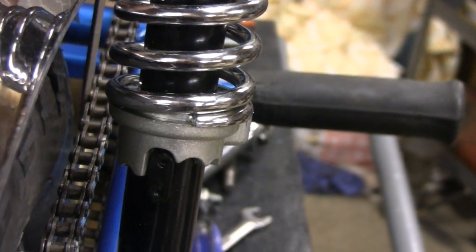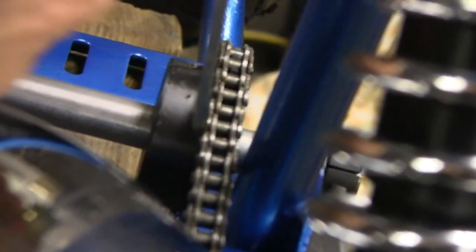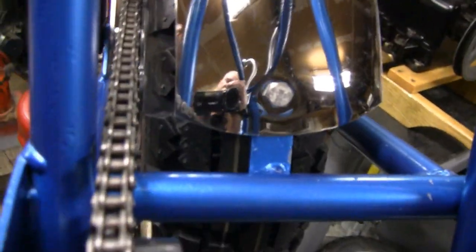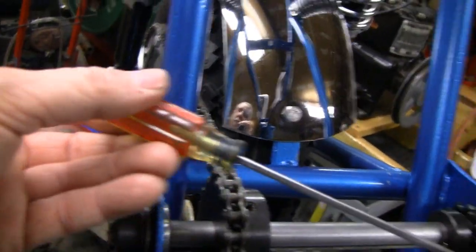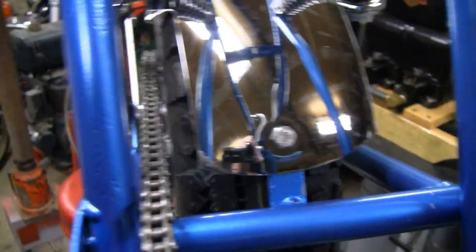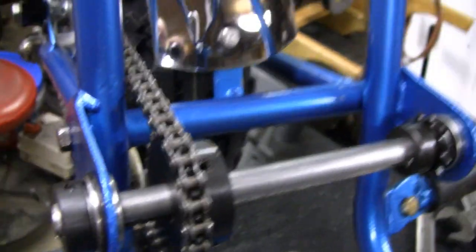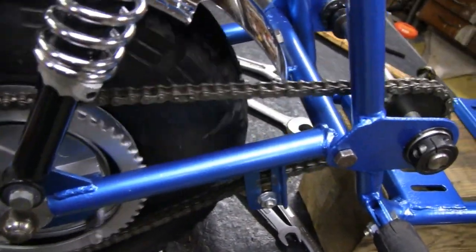That's looking at the rear, that's on the left. And then up front there's only a sixteenth. So I got an eighth on one side and a sixteenth on the other. Right here — it's just a little itty bitty screwdriver too and I can just barely fit it in there. But the chain's straight. You know, it actually straightens itself when you fit it in between there. But it's spinning good and everything.